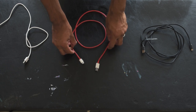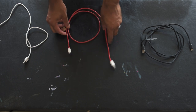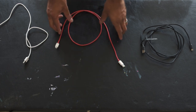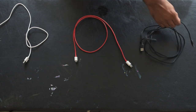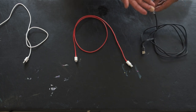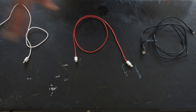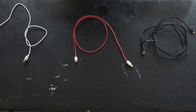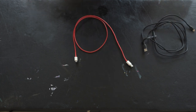This is a really nice cable that came with my OnePlus a couple of years ago. This is a Gen 1, which is rated up to five gigabits per second, which should be more than enough for Android Auto in the car, but sometimes that's not the case. So I ended up picking up this Gen 2 one from Amazon — also USB-C — at around 10 or 12 gigabits. These two cables should work. You want an actual USB-C Gen 1 or Gen 2. Try that and see if that works.